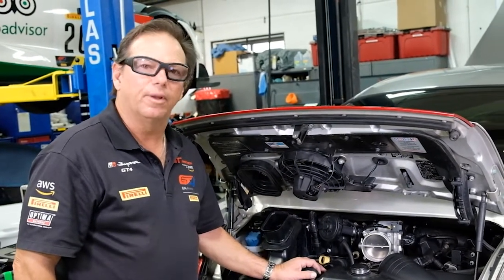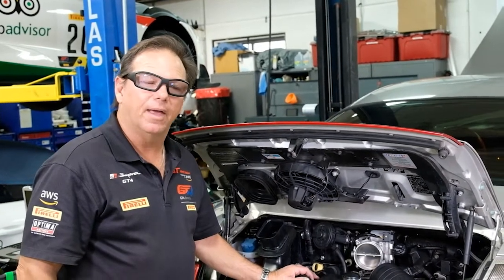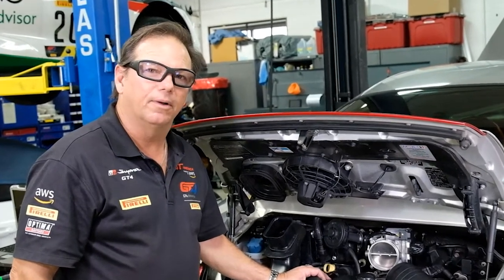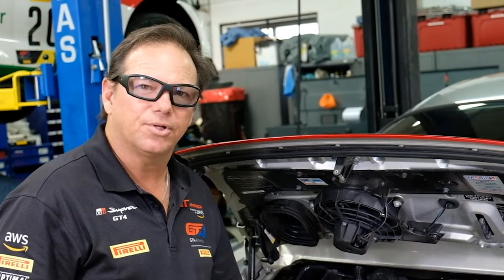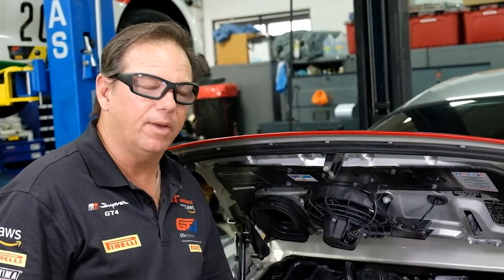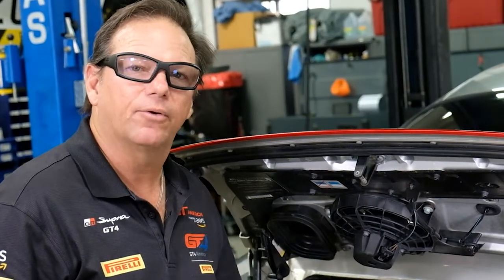The coolant pump — the coolant water pump has an impeller that, like a fan, moves the coolant, and that impeller is generally plastic. I would replace it personally every four years or 40,000 miles. You definitely want to make sure you do it often. Anytime before we replace an IMS bearing or do any heavier engine work, we make sure we check that water pump and coolant pump first.